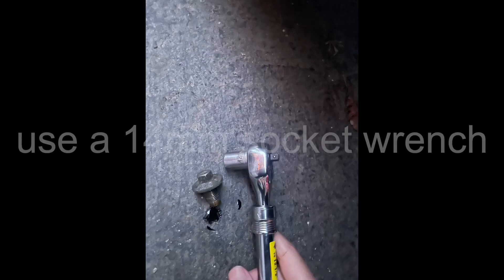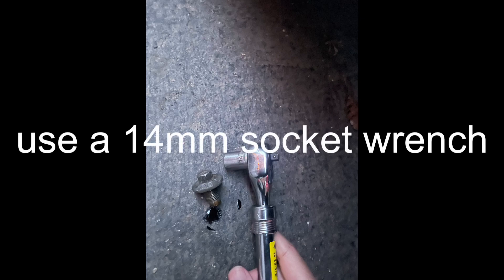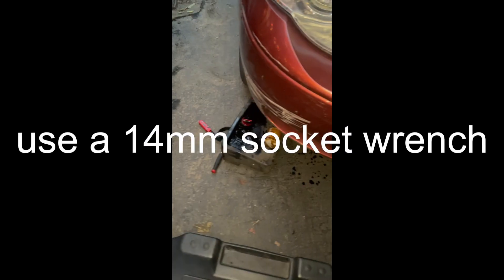So you can see I'm already here draining the old oil — it is blackened. I'm going to be replacing it with approximately 4 quarts of the 5 quarts of oil that we bought. We got the oil filter off and took out some of the oil. For some reason it was lacking oil. And there are our tools.